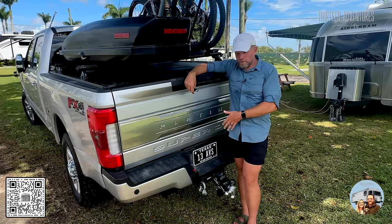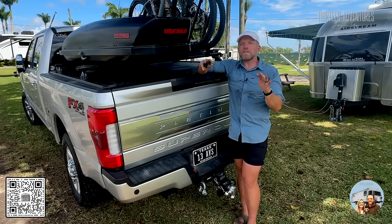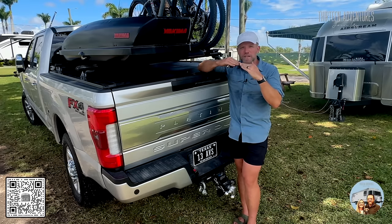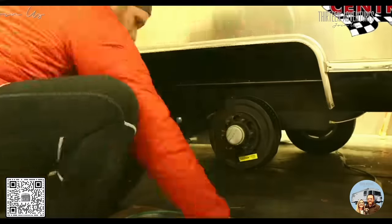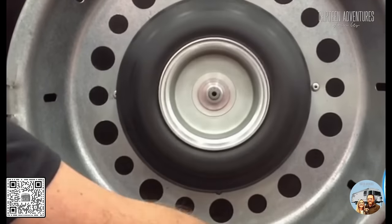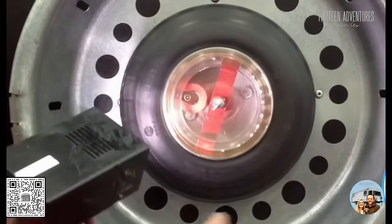So no hitch. I haven't had any front end separation issues, no buckling, no rivets coming out, nothing like that. And again, I believe that's largely due to people towing with such a rigid weight distribution hitch. It just keeps it so rigid all the time. There's no give and no take, and that causes everything to vibrate so much. One other reason I believe I've had no issues is my Centramatic wheel balancers. They have proven fantastic for lessening the vibrations inside the trailer.